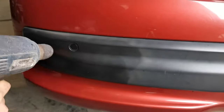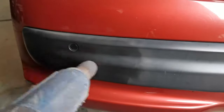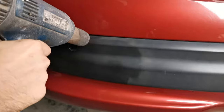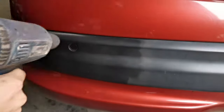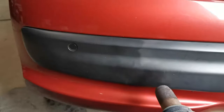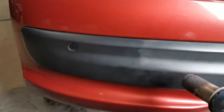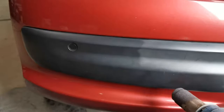Ultimately this just comes down to practice, although until you are practiced with it just be really careful of your paintwork. The reason this technique works is basically because when a bumper goes from black to grey it's generally from years of exposure to UV rays from the sun. This basically opens up lots of pores in the surface of the bumper making it look a lighter, greyer colour. Putting heat into the bumper essentially melts these pores back together giving you a more solid and uniform dark black look.